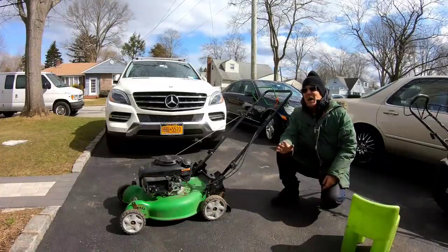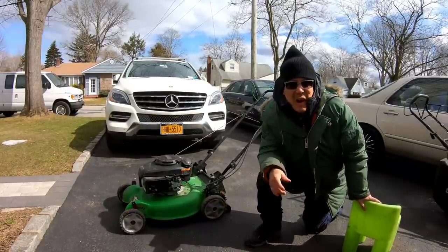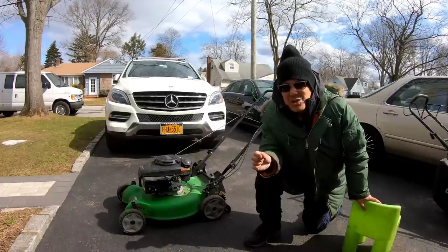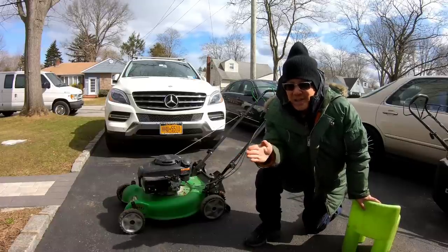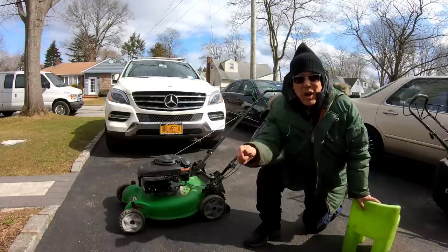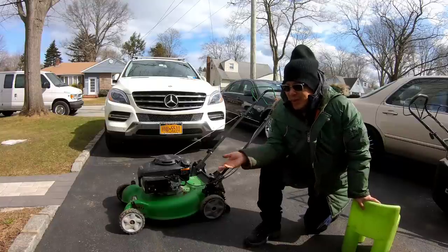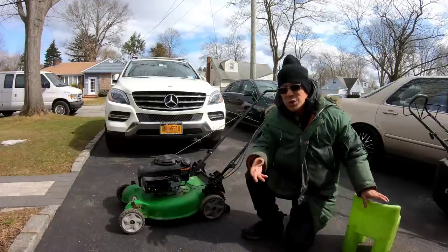Okay, I did a lot of unnecessary stuff. If I was just a little bit more careful when I took off hoses. I was impatient, so I just yanked the hose without actually loosening the hose clamp first. So as a result, I broke that little plastic nozzle that's off the primer bulb, auto choke primer mechanism, where it has kind of a diaphragm inside so that when the throttle moves, it pumps a little bit of primer in there. That's kind of important with an auto choke feature, you know? So luckily I took the old one out and put it on this one, but it was too much trouble, so I decided to just remove the entire mechanism from the bracket. It's what you saw in time lapse.